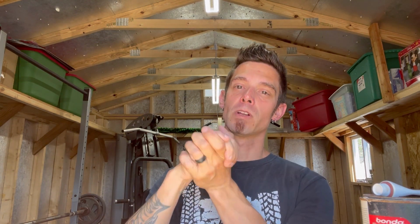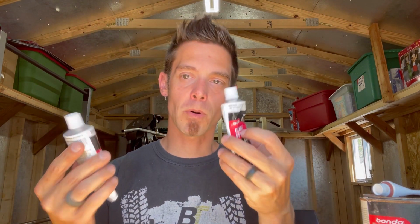You'll see in the video when I start applying this stuff, I'm not caking it on super heavy. Your main goal is to fill in just the defect. You don't need to glob it on and layer it all over the place. You're not icing a cake, you know what I mean? You just want to reduce the defects. The sanding really should be a top priority. You want to sand down as much as you can, and then you want to use different components like this, based on how bad your PLA lines are, to help fill those in and smooth them out. And like I said, with each step, you're going to gradually go up with your grit of sandpaper. You never want to keep it at the same grit, because you want all of those fillers to kind of build up.